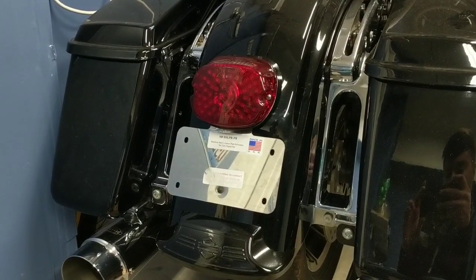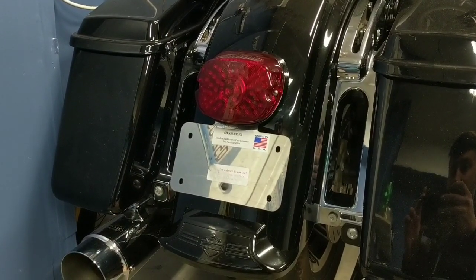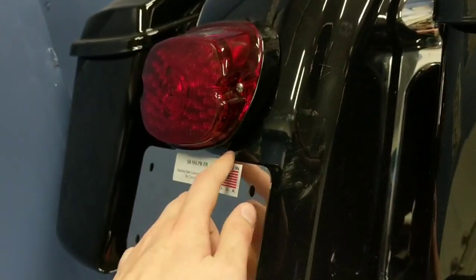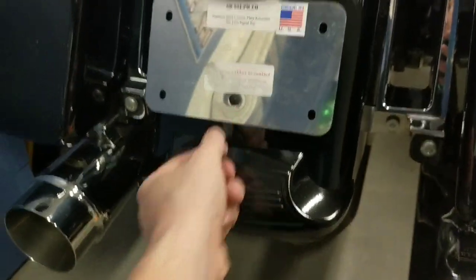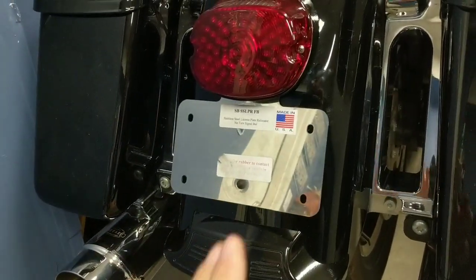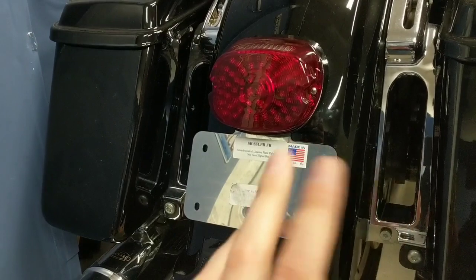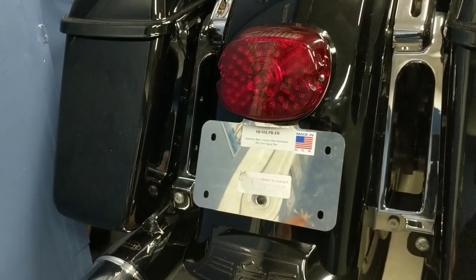So this is what it looks like installed — very, very easy, so much so that you don't even really need to film it being installed. You will need these pliers to go ahead and bend those little ears that go over the bracket to make sure it fits firmly. As long as the rubber nipple on the back of this is touching your fender, that's the angle you pretty much want this bracket at. If it's not, it puts a lot of stress and you can have issues with vibration or it coming out of place.